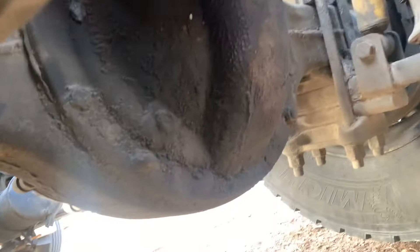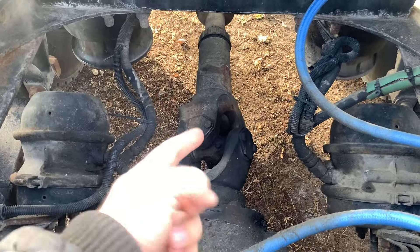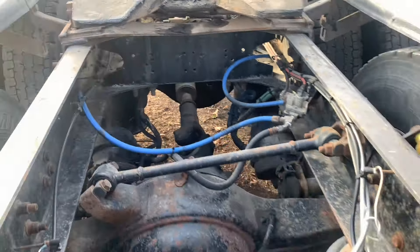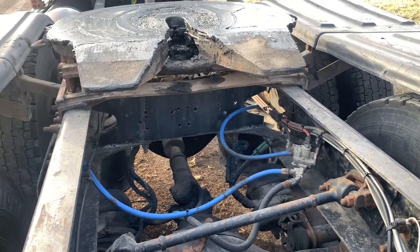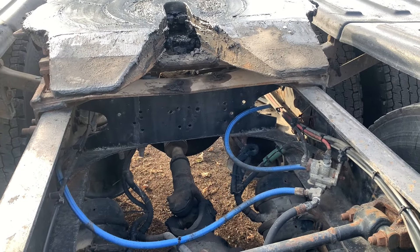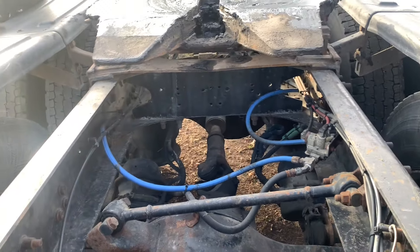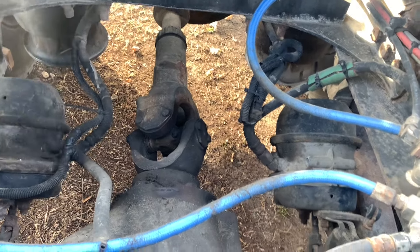Now is the perfect time because these have the pressed-in caps on every side. So in order to get that seal fixed, I have to take apart those U-joints. I'm just going to do both of them and do the seal — and just be done with it. Maybe I'll even get this seal too. I probably should.